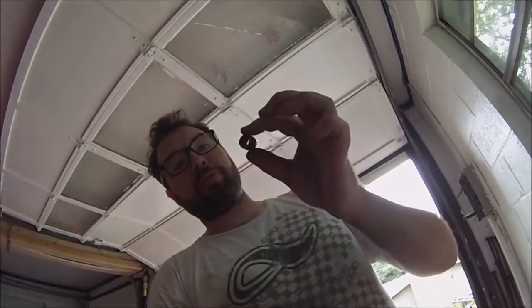You could probably really damage it. I was using a rotary tool and I started with the coarse sand — it was like a round point bit. Then I moved over to a larger one; the smaller one broke. I moved to a larger one and it worked pretty well actually, but it doesn't have a long enough shank for me to really get back into the crevices. Then I moved over to the little sanding drums and these things work really well actually.